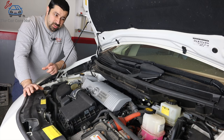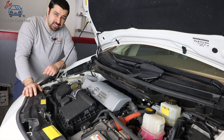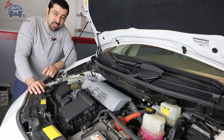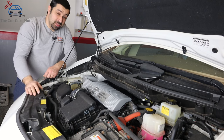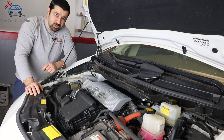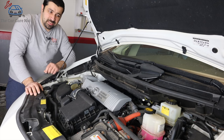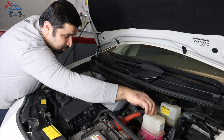If you're not sure which one is which, you can open both caps, start draining one of them, and the one that comes down is the inverter, because we're going to start draining the inverter first. But the first thing we're going to do is take both caps off. If you have a radiator cap, make sure you take it out as well. Be careful — we're going to try to do this when the engine is cold to prevent working with hot coolant. Let's take both caps off and go underneath the car to start draining.